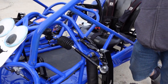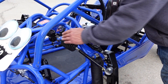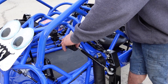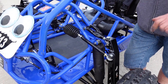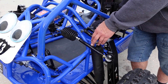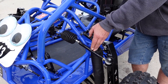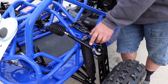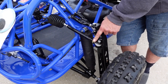This is a stock steering rack and it's an offset rack. If you look at more modern strut buggies, they usually have an even rack where the boots are the same length, but on these older buggies the rack is off-center — the driver's side boot is shorter than the passenger side. So I needed to use the stock rack, cut the tie rod, put it on a lathe, turned it down to fit inside a half-inch bung, and welded it up for a half-inch heim joint on the end.